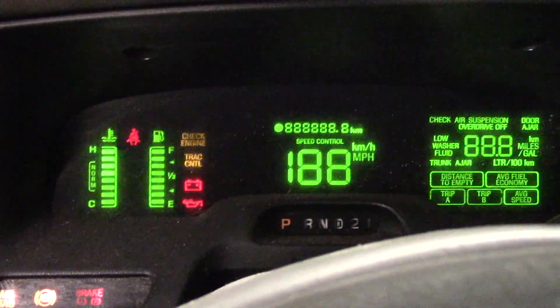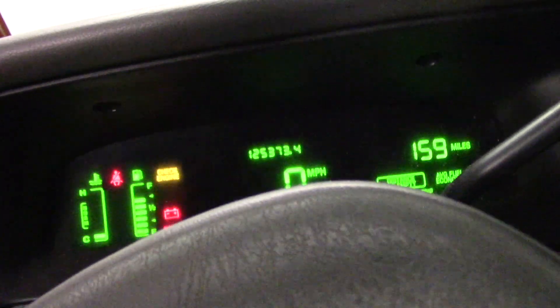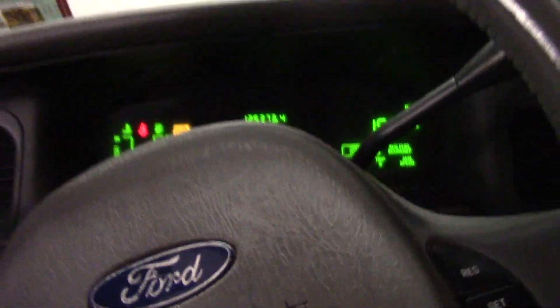Okay, so this is what it's doing. I hope you can hear that. Now, the first thing you would normally do if you have a car that doesn't start like that is take a look at your interior light. If you turn the key and that interior light goes out, then we know we have a problem with the battery, the cable, or something like that. You don't see any change in that at all, so we know the cables are not the issue and the battery is not the issue.